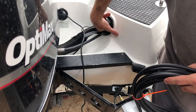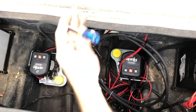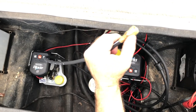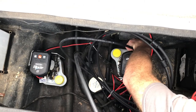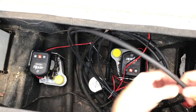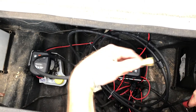For the first pole on the driver's side, I'm going to run these lines through here and into the right-side pump. Your pumps will be labeled — the up line has a blue cap on the line and a blue cap on the pump. These are five-eighths connections. Run them down to your pump, making sure up goes on up and down goes on down — that's all you have to do.